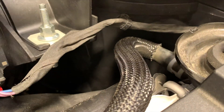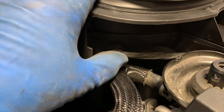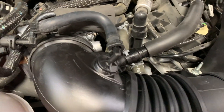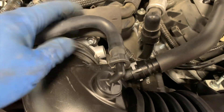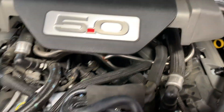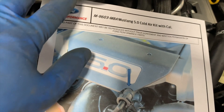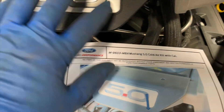Rather than drill off the car, just get everything lined up, mark where it's going to go, then drill. You don't want to go too big too quick — I just got lucky with the first drill bit size I picked; it was perfect. On 2015 and 2016 Mustangs, you have to actually cut this hose and there's a supplied T that goes in. But this is a 2017, so the hose is bent perfectly — just clip that in place. Connect the PCV hose into the intake tube. Make sure all your connections are tight and everything's plugged in. The last step is to clearance the engine cover just a tiny little bit — a little at a time, because you can always remove more but you can't put it back.